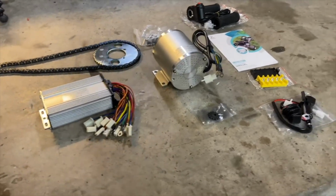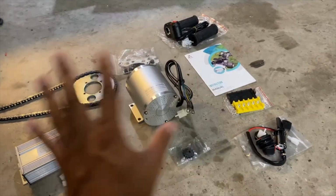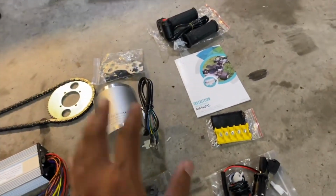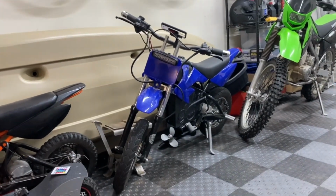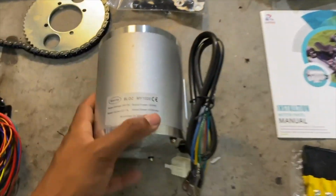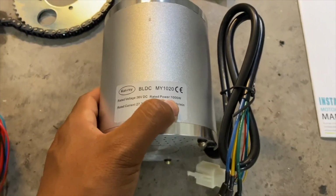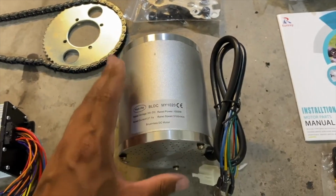Here's everything that we're gonna be using for today's project. Now, if you followed my channel for a while, a lot of this stuff's gonna look very familiar to you. That's because I used a very similar kit on my blue MX 650 back when it was a 48 volt setup. This is a MY1020 Brushless Kit by Kunray, and it's rated for 1,000 watts, which is a lot less than what's on my bikes, but this is plenty for this quad.